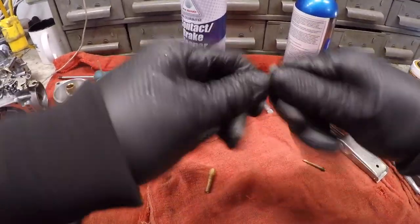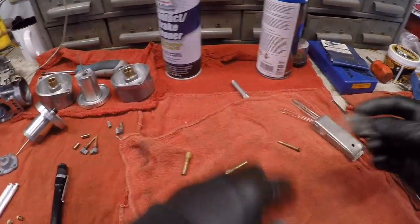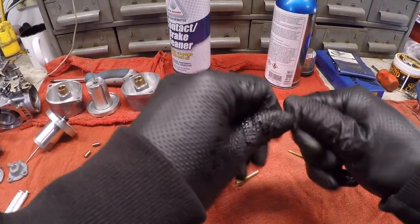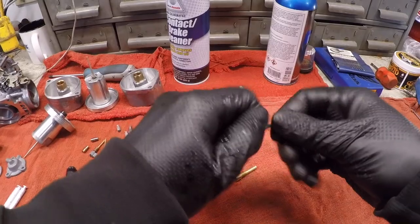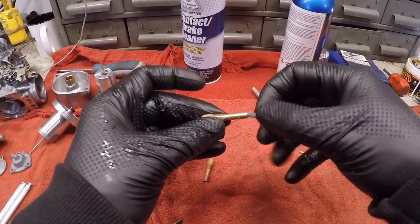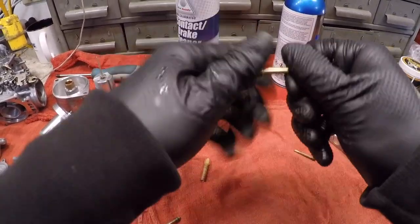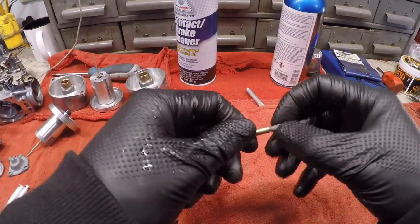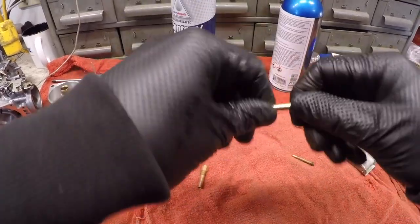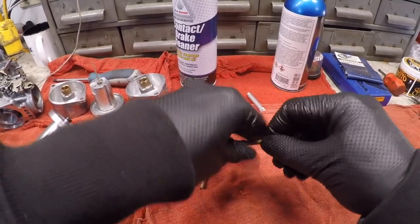And then I'll do one extra thing with these, and I'll show you, then you guys can get to work. So what I'll do, I'll take that same piece of steel wool and I'll make a little bullet out of it. Kind of thick, but not too thick. And I'll run it on inside of this emulsion tube. And as I'm going in, I'm spinning it and tightening it so that I can see it come out the other end. If you can't get it all the way through there, which now I am, right there at the top, and I'll just spin this emulsion tube.